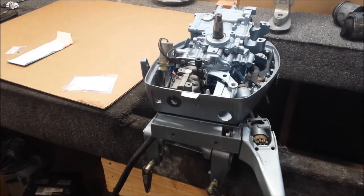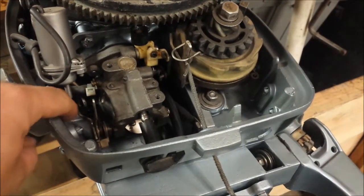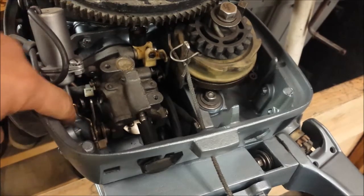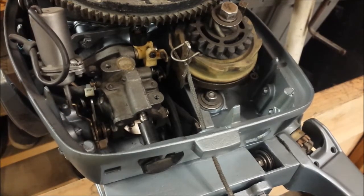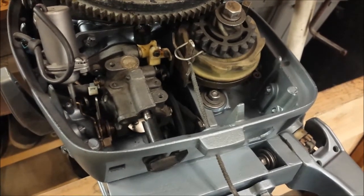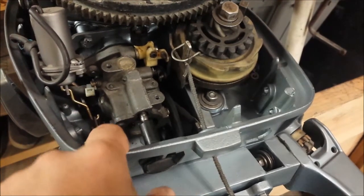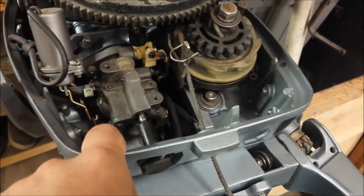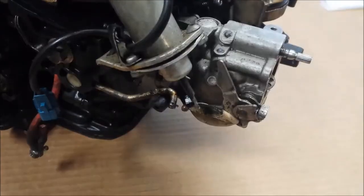What I was hoping to find was a link version. Let me show you the two. On this engine there is a spring link that goes in there and activates the choke. I was hoping to find another one of these because when you need to take it off the carburetor or the choke, you don't need to cut the cable to get it off. I couldn't find one and I didn't really try my metal working skills to bend all those links.